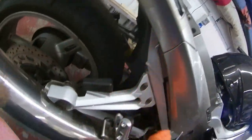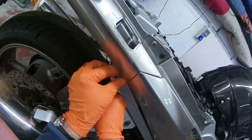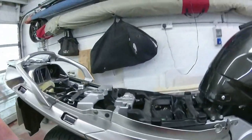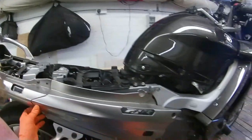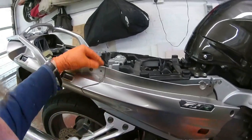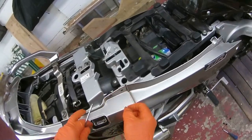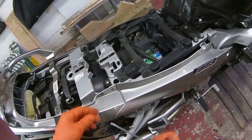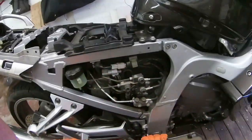Next thing is to remove the side panels. Again, we've got a nice little mixture of cap screws and plastic fasteners. There's quite often little hidden ones somewhere, particularly on the far side with the grab rail — always a good idea to check. In the manual they'll say you can just slide this out, but I really don't think that's a very good idea. It's much better if you release this particular screw here so you don't put any strain on it. That crack by the way was like it when I got the bike — and remember, these panels are not going to be as flexible as they once were. This bike is now 2010, one of the last of the Gen 2 variant.